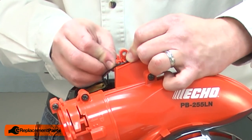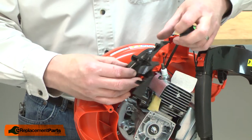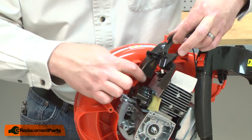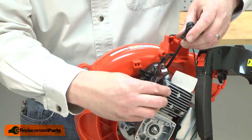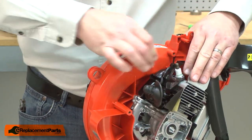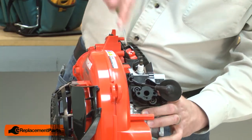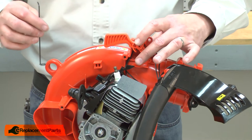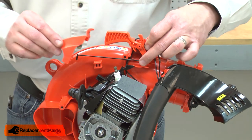Next, they go through the groove on the front of the housing. Next I'll install the plastic guard — it slides behind the isolator. As I install it, I need to thread the spark plug wire through the notch. Now I'll reinstall the trigger and the throttle linkage along with the linkage cover.